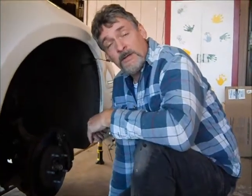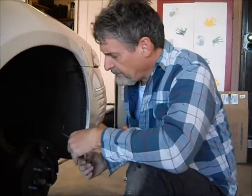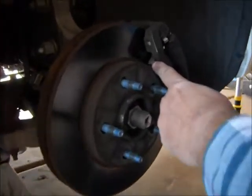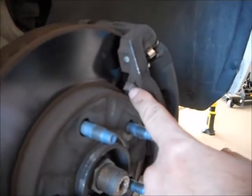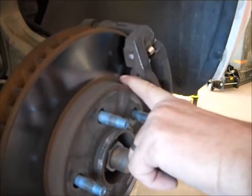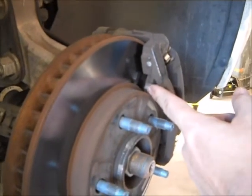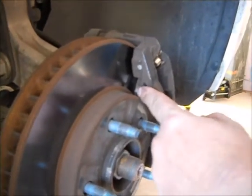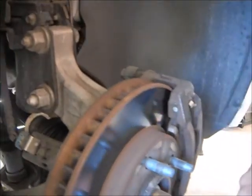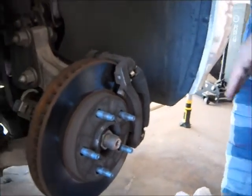The original complaint on this car is the brake pedal going to the floor. Take a look over here — this little metal device is the sensor to tell you if your brake shoes are worn down. That metal device would come in contact with the disc brake and start to squeak, letting you know your shoes are worn. In this case, there's at least a solid quarter inch of brake shoe left, and I see absolutely no leaks anywhere along the brake lines or any brake fluid coming out of the disc caliper.